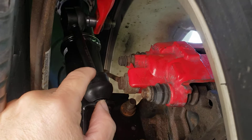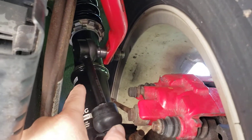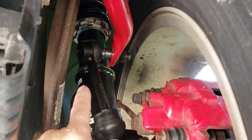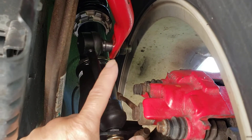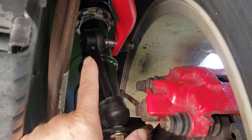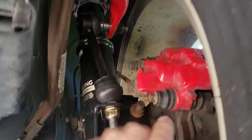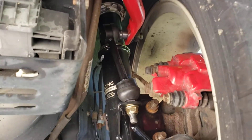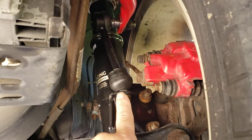So I don't know what model it came off of or what year, but this is what we used. This is a link from a Ford F-150. We had to drill the bar out a little bit to about a 5/8th hole, and it makes this angle this way and then this way.